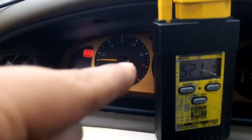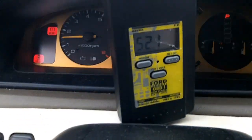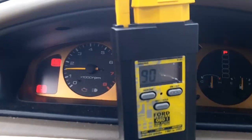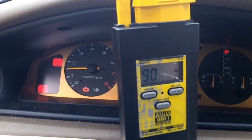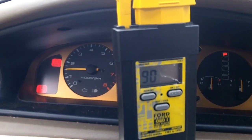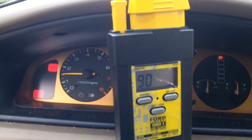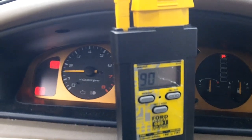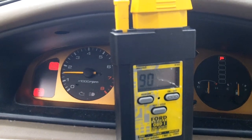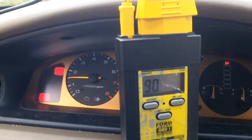There goes the check engine light beeping on there. It will be all 90s — there's a 90 for cylinder one. Why is 90 passing? Because EEC4 can handle up to eight cylinders. So if cylinder eight was bad it would be an 80, cylinder seven and so on. Since this is only a four-cylinder car, I can only possibly get 10, 20, 30, 40, and 90 for a pass. Since these are all 90s, we're looking pretty good.